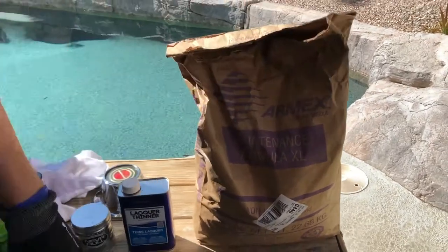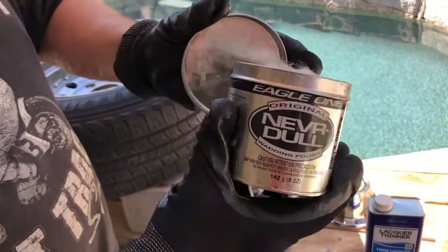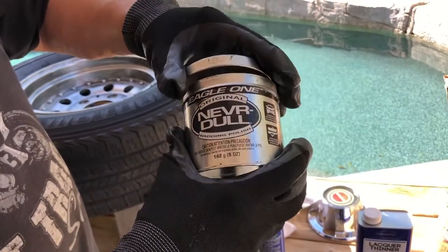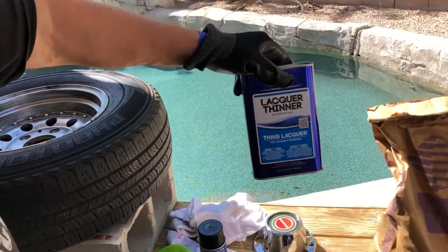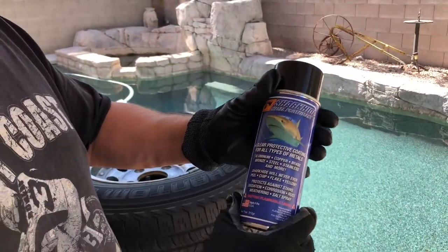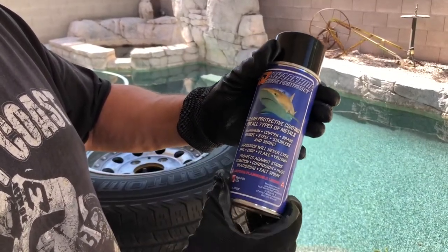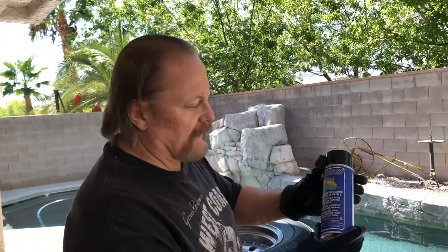It's just less aggregate, and a regular sand blaster would probably do a lot of damage to the wheel. Other products I use in this process are Neverdull wadding — it has some kind of chemical cleaning agent — and you buy this at the hardware store. Also, you'll need some regular hardware store lacquer thinner. After you're done cleaning everything and get the wheel all clean and shiny, you may want to use some Shark Hide metal protector, or any kind of metal protector, just to make the finish last longer. Shark Hide is a good product, or else you can just use regular paste wax. It gives it a shine too.